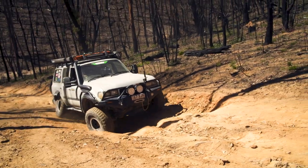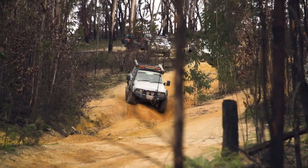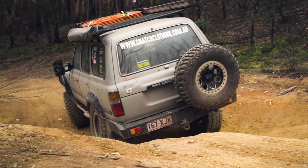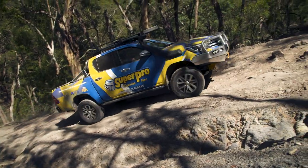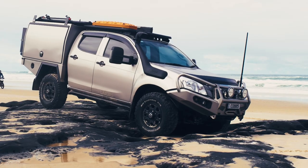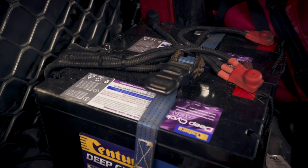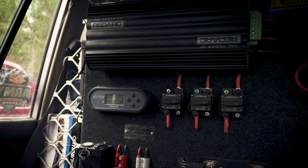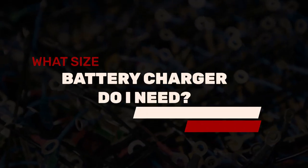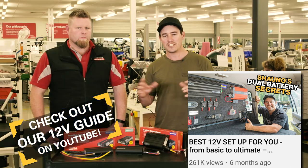Most vehicles before 2008 have a fixed-voltage alternator, which puts out a constant 14 volts to charge your battery. However, most modern four-wheel drives have smart alternators, which vary the voltage output depending on engine temperatures, vehicle loads, and driving conditions to reduce engine load and save fuel. Isolators need the voltage constant to work — when a smart alternator drops the voltage output too low, the isolator won't kick in and won't charge a second battery. If you want to learn more about choosing the right size or type of charger for your particular four-wheel drive, we covered this in much more detail in a separate video — the link is in the description.